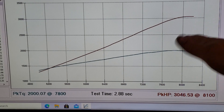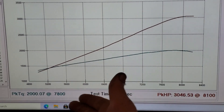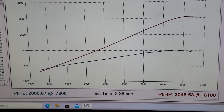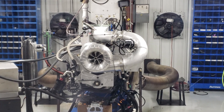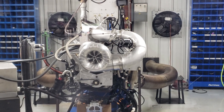The RPMs out here — it's not falling off a cliff, I just have it lazy up here intentionally. We're getting this thing nice and sorted out. We're making 2000 foot-pounds of torque, with peak torque up at 7800, which tells you it would basically roll over at about 8800 or so naturally. I was actually trying to run it up to 8500 but only went to 8300 — not a big deal. I think that is a super good piece. We'll bring it back, get it all sorted out, put it on the hub dyno, make sure everything's working in the car, go to the track, and work on the street tune. I'm Steve Morris, Steve Morris Engines — have a great day.